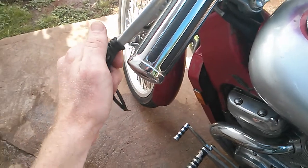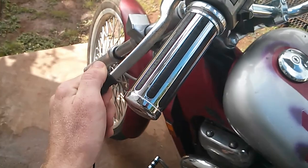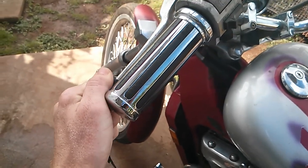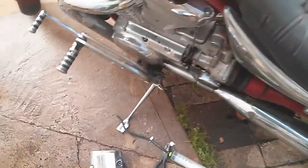I can't start it right now because I just need to charge it. But you can see — when I pull the clutch lever in, that's when I start to feel pressure. I can pull it in like normal, start to feel pressure, and then all the way in. So that's basically how you bleed a system that's completely dry.